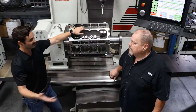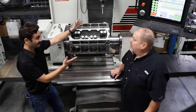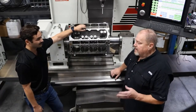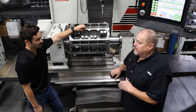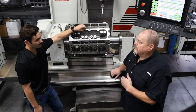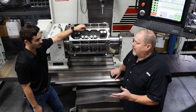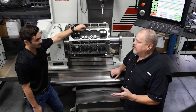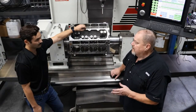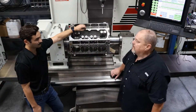So start this off — why are we doing it? Well, I put it in perspective like when you index your camshaft in, you have to know exactly the crankshaft degrees and the camshaft degrees. It's the same thing with the lifters. If the lifters are not centered — in different positions throughout the block — you lose that fine tuning that you need. So you need to know exactly where they are, where they're located, and that it's not going to become a problem in the future.